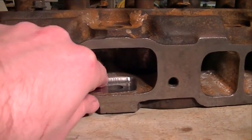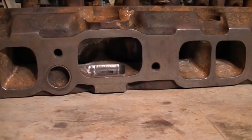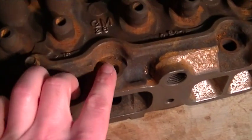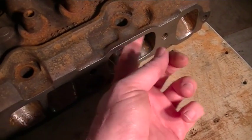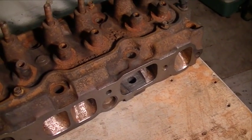There are little sanding discs in the cylinder head porting kit that I bought, so I'll round those off. But what I need to come in and do right now is tap out these open holes here — there's no boss under there, so we've got to tap those holes out and put a pipe plug in there.